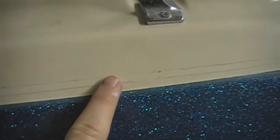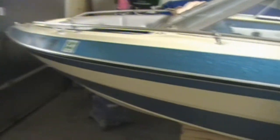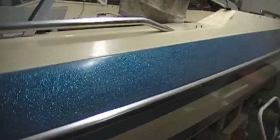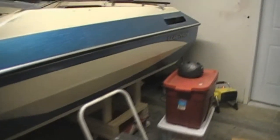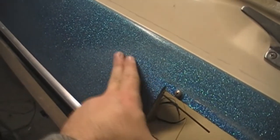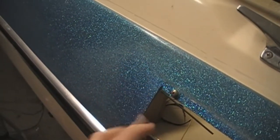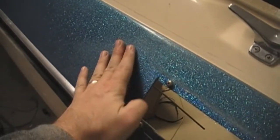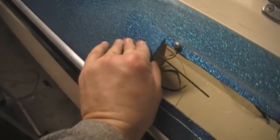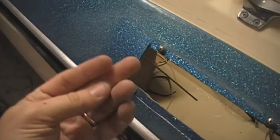If you look real close you can see the dirt mark left over from the pinstripe all the way down the side. I'm getting all that off so I can completely clean the hull and get it ready for the Polyglow. It still has a decent shine but not like it used to be. In some areas you can see some really bad oxidation — I actually sanded this down with 500 grit, getting pretty aggressive with it. It had kind of a greenish color to it, but underneath is that beautiful royal blue, and there's no glitter coming off yet so I haven't gone too deep.